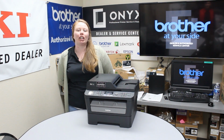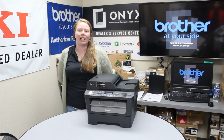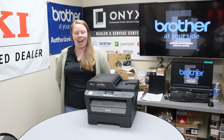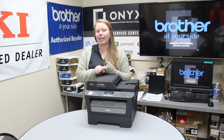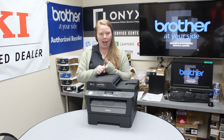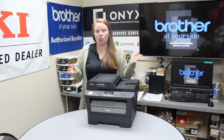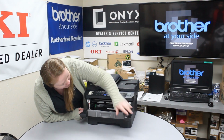Today I'm going to show you how to replace your toner cartridge, and I'm working with the Brother MFC 7460DN. So this printer takes a TN420 or a TN450. The 420 is your low yield, the 450 is your high yield, and the high yield is basically just more ink. So first thing, go ahead and open your front hatch here.